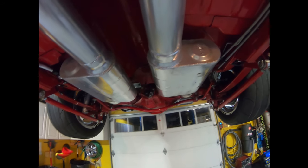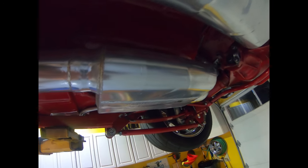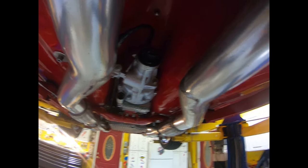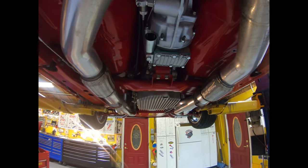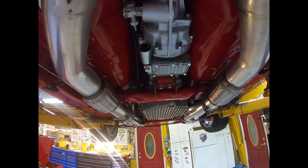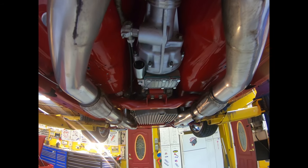The drive shaft is no longer here. It's been sent out. What we've got is about a half inch to 5/8 of play between the drive shaft and the rear for a measurement, which is what they want. And we've got our fluid out on the countertop so that I don't forget to fill the overdrive unit. All right, I'll bring you back once we have the wiring done, and I'll show you where we lay it out.